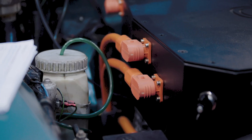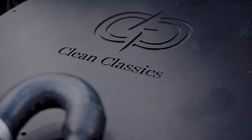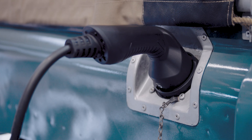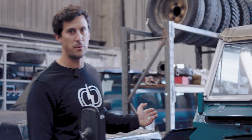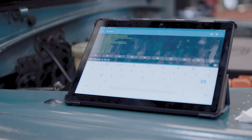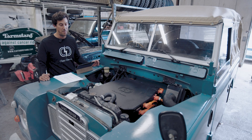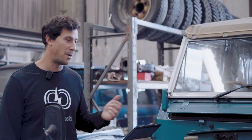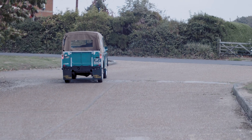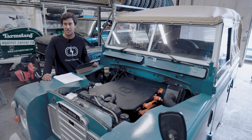On the Series 3, we're coming to the end of the road in terms of getting it set up — we're going to take it back to its owner on Friday. Really happy with how the system's gone in; it's actually driving better than it was before. The last few days we've just been getting the charging dialed in and it's happily sitting there charging now. Another new feature we managed to add with this new system is that the brake lights now turn on when regen is active — a nice little added safety feature that's working really nicely.